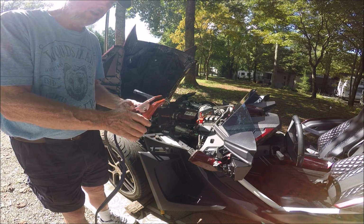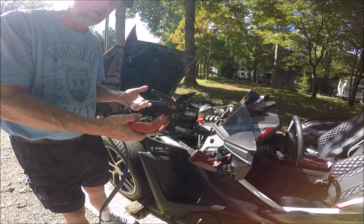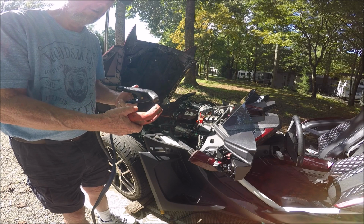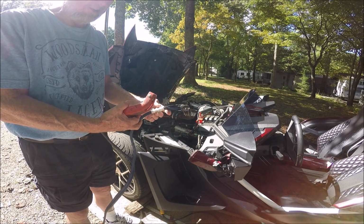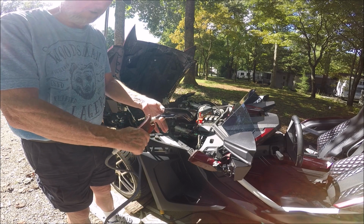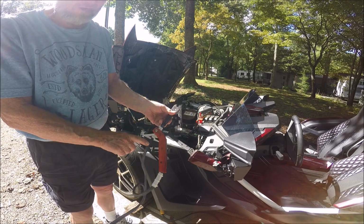You don't want these things to touch once you've got them connected to a live power source like the starter battery of the starting vehicle. So if they come into contact, even these rivets. Now, I put a little insulation in there. That's just a sheet of plastic that I wrapped around, and give me something to squeeze against without crushing the cable and possibly causing a short.